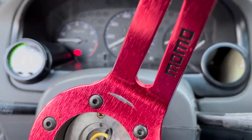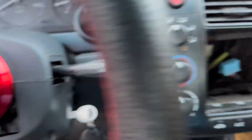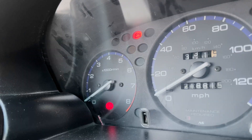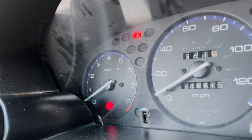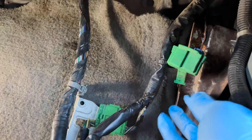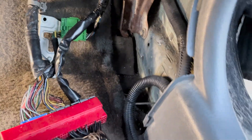Perfect, beautiful — now we know it's good. I'll go ahead and plug in the pin so you guys can see the check engine light stays solid. I'm gonna put the safety pin on the connector right here — solid, look at that, perfect. Once you're done, go ahead and put the little socket cover back. That's basically it — that's how you check codes on a Honda or Acura equipped with OBD1.